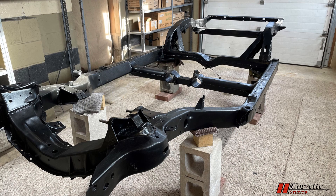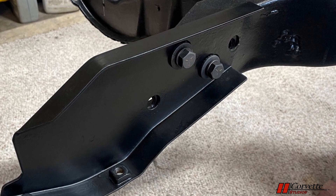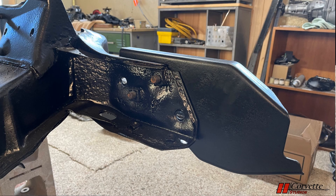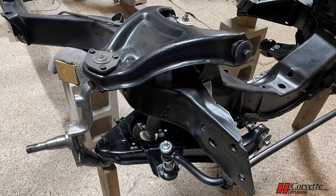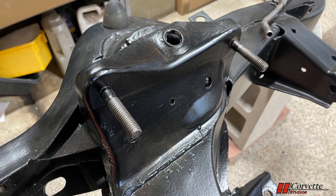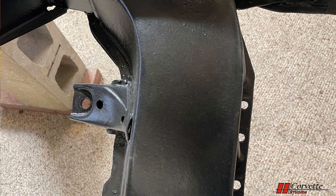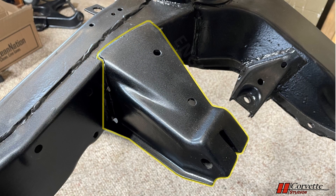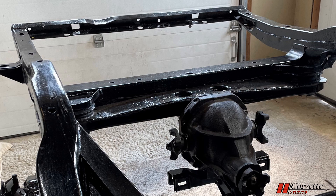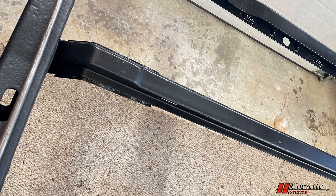There are a number of additional steel members and brackets that attach to the frame. Two front extensions bolt to each side of the frame with two bolts and washers — these support the bumper side brackets and the bottom front crossmember. The front suspension connects to the frame at four points: the upper control arms attach to studs in the frame at the raised front tower, and the lower control arms attach with three bolts on the bottom side of the front crossmember. Just behind the front crossmember are two short extensions that support the engine mounts. At the rear kick-up of the frame, the differential crossmember attaches to the underneath side of the frame, and just behind it is the gas tank crossmember that supports the front of the gas tank.